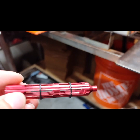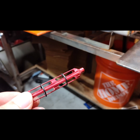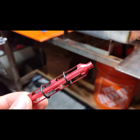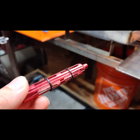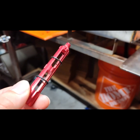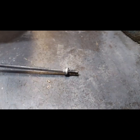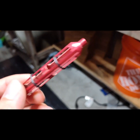I need to put the rebound adjuster back in. These adjusters can come loose and either drop out or rattle — even if they're not loose, they'll just rattle because it's got a really small hex attached to it. Fox puts one o-ring on, but I put two — it keeps it quieter. Doesn't eliminate the noise completely, but this is what I do. And I'm going to install that little bolt, and that's it. Re-pressurize it and it'll be good to go.